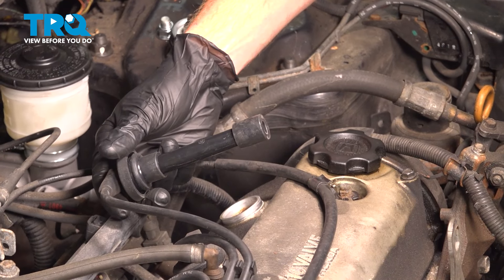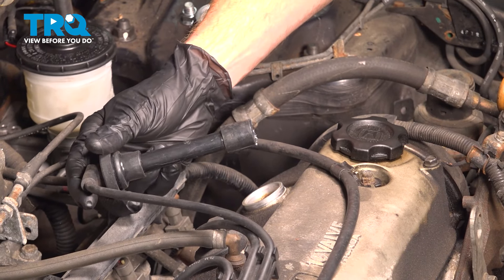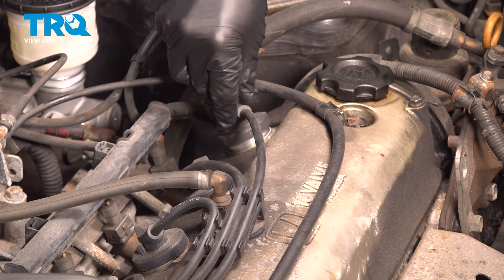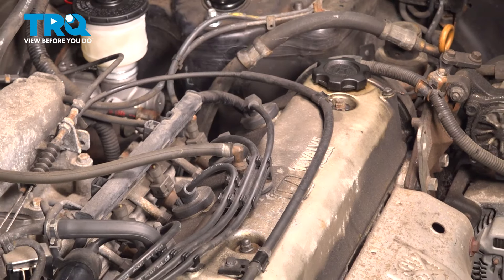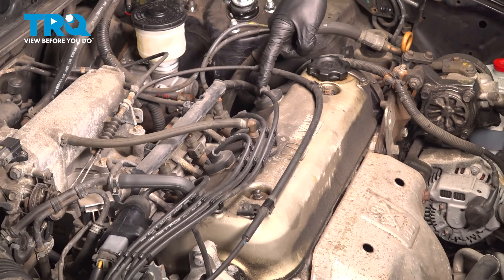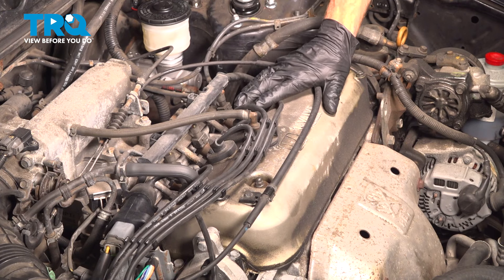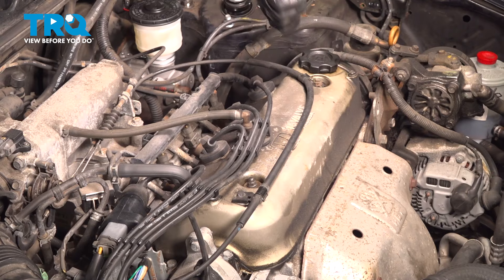It's time for the spark plug wire. We've already inspected it. Let's apply a thin amount of lubricant directly along the boot where the spark plug will sit — that'll help it slide into place. We'll press that right on there, give it a little wiggle, and make sure it's secure. The process for one is the exact same thing for all others. Once you've done that, go ahead and start up your vehicle, make sure you have no running condition issues, no check engine light, and take your vehicle for a road test.